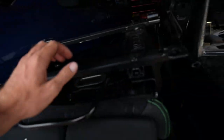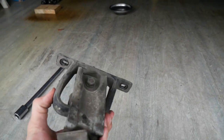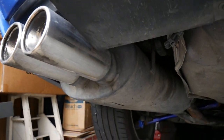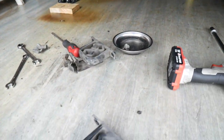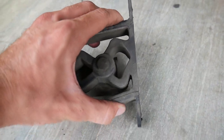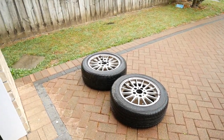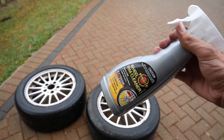We're going to chuck in the seats now. Hopefully the rain will stop so I can do that, and then there'll be some skid rims going on the back and we're ready for skid day. Another thing I'm going to do is replace one of the exhaust mounts because it's shaking around a little bit and one of them seems to be cracked inside. I've dropped the exhaust and checked both hangers — the other one's all good, but this one is split all the way through, that's why the exhaust is wiggling around so much. I've got another one here, a secondhand one but in good shape. The new exhaust hanger is on, which is awesome.